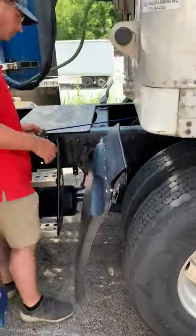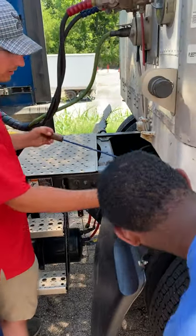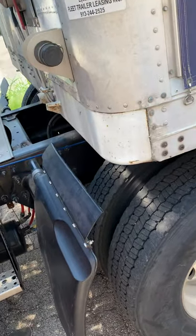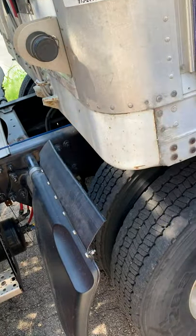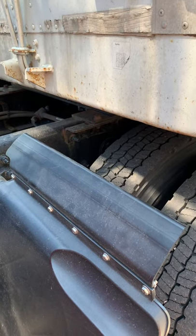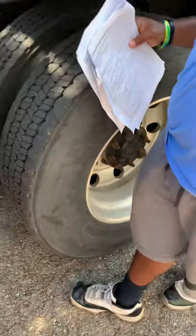When you're doing the back of the cab, go ahead and step over in here because you can see all the parts right here. When you're on the outside, them tires hide everything. So we kind of step up in here and look. I've got my axle — it's not cracked, damaged, loose, or leaking. My torque arm is not cracked, damaged, or loose. My frame bracket, high bolt, control arm, and U-bolts are not cracked, damaged, or loose.